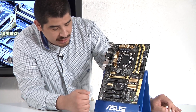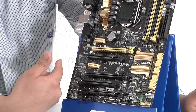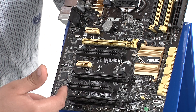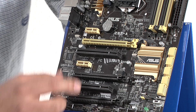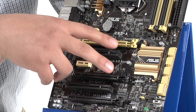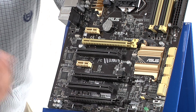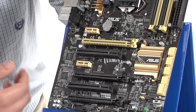Moving over to the PCIe slot expansion, it's pretty capable. You've got a x1, an electrical x16, then a PCI slot for legacy devices like an older sound card or capture card, another x1, another physical x16, another PCI, and then another physical x16. The motherboard fully supports Crossfire and SLI — with one graphics card it runs at full x16; with two graphics cards in SLI or Crossfire it'll be x8/x8, which is x8 Gen 3 — technically equivalent to x16 Gen 2, so more than enough bandwidth. The last slot's speed can actually be changed within the UEFI depending on your configuration parameters.